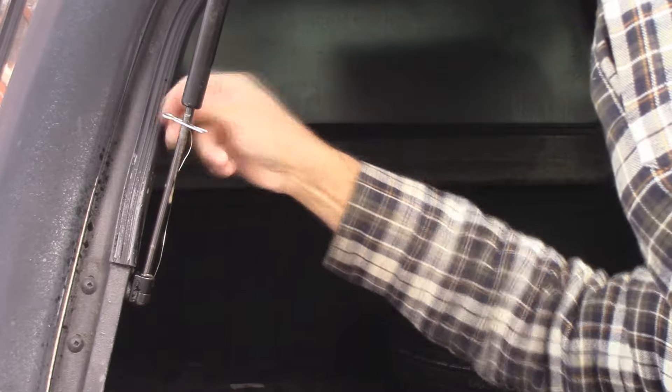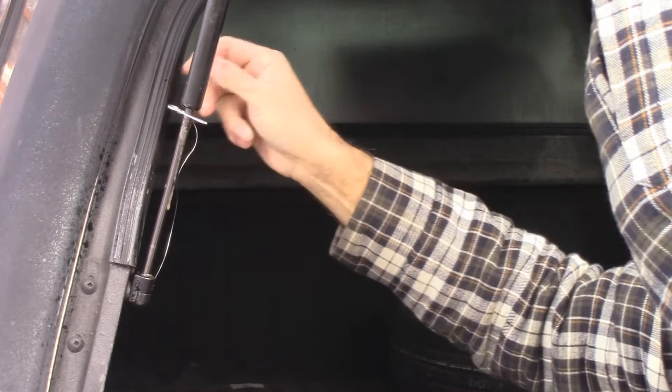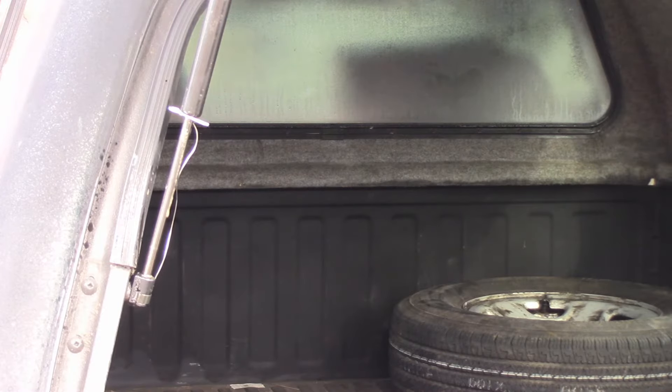Take that out, drop it down. Now, without all this grease here, you'll be able to see that little slot. And that's it right there. So that's the whole idea behind this little hack. It's easy to just cut the slot with your angle grinder and put the pin in. Because they're gas charged, when you put a slot in the side there, as it goes past the seal it's going to leak out all the fluid and all the air. So that strut was completely useless already — I couldn't do any more damage to it. So what I did was I cleaned off all the grease and just left it in the top position until all the gas escaped. Now it's just bare, and you can see the slot easier. You can just close it and open it anytime you want now.